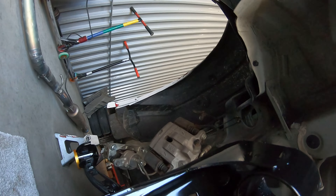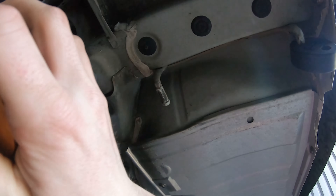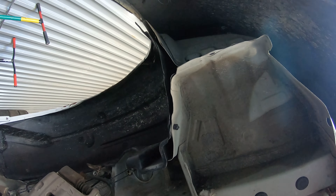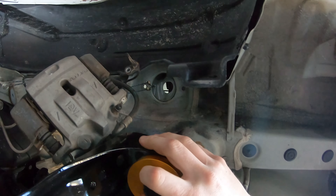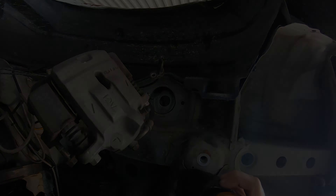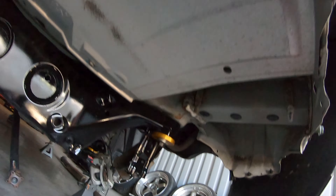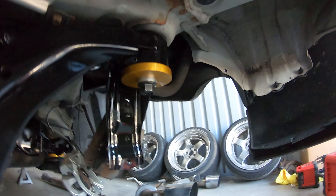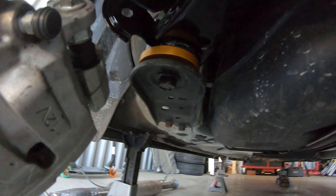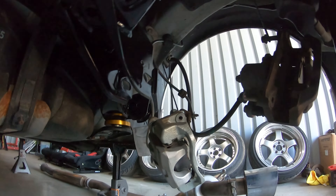Of course the one I have access to, the bushing fell out - let's get that back in there. Subframe is in. It's actually kind of a pain to get this thing held up square and then get the bolts in - I think it's just because the bolts were epoxied. The back bolts get two washers since I'm doing the maximum rise on the subframe, and then the front gets one. Then that support plate's got to go back in. Subframe is in.